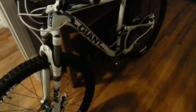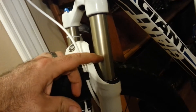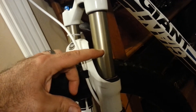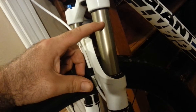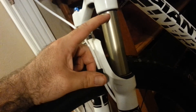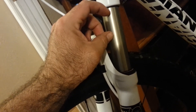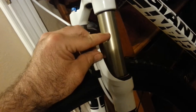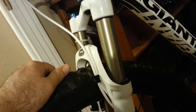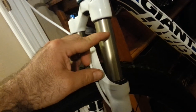You'd be surprised what a bike can do. I've seen a guy come back from Downieville with the indicator all the way down — and Downieville is a gnarly trail. If you're all the way down on something as hardcore as Downieville, it's going to be a nightmare to ride. A Downieville run should have the indicator up in here somewhere. If it's all the way up you're too close to bottoming out, so the magic zone is somewhere in between, depending on your personal preference.